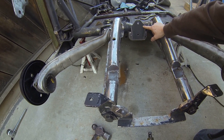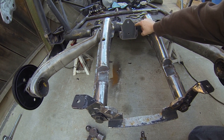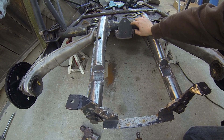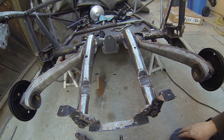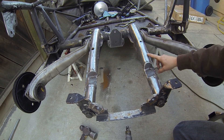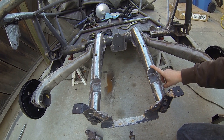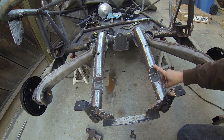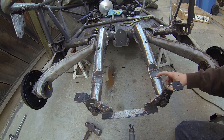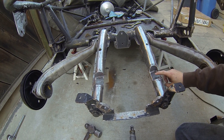On the front I made a quarter inch plate transmission mount and welded it in. Since my rear transmission mount sits a little bit lower, I had to notch out the trailing frame arms. I notched these out and welded in quarter inch pieces.